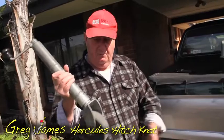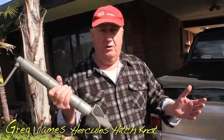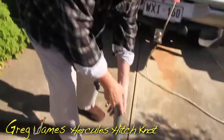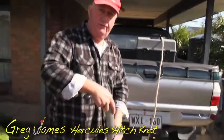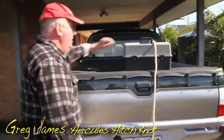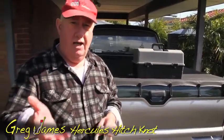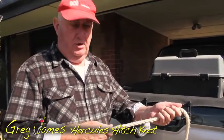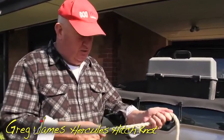Mine's not. I've got a fairly big boat — 6.5 metre — and I've used this trick with it, so it works really well. Get yourself the jockey wheel, put it onto your trailer, wind it in, and chock it and handbrake it so that it's lodged and firm on your boat trailer. Then what really works is the piece of rope. What I'm going to show you is how to get your car to jackknife the trailer up out of the sand. Here we are with our piece of rope — I've got fairly heavy gauge rope, and I do that for a reason because it's stronger and nylon rope's got a lot more strength and tensile activity to its strands.